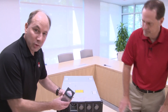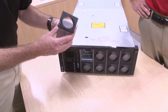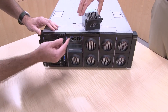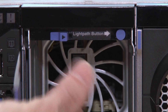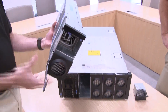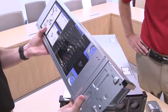I've pulled out one of the hot-swap fans. These are in front of the compute books. So let me show you how to access the compute book. The fans themselves are hot-swap, but the compute books are not hot-swap, so you need to power the server down before removing those. To access the compute book, you remove the top fan, then slide this lever across — that releases a handle, which allows us to easily pull out the compute book. You can see the innovative design in that the memory DIMMs and components are actually on both sides of the compute book.